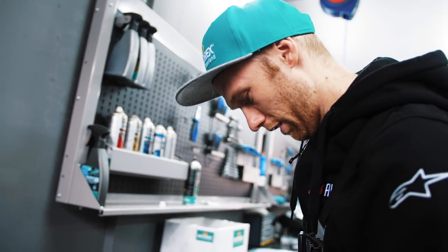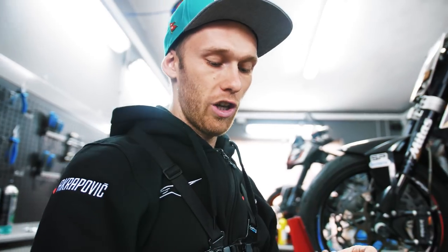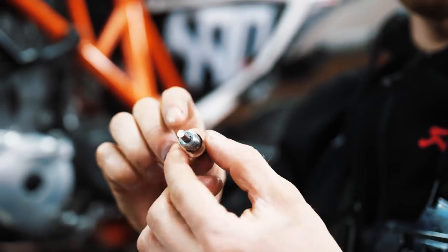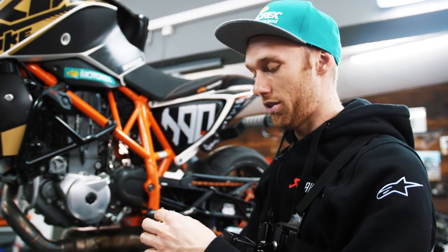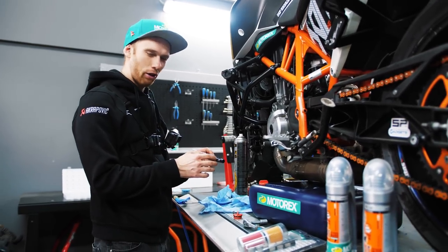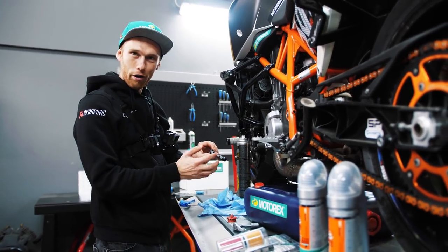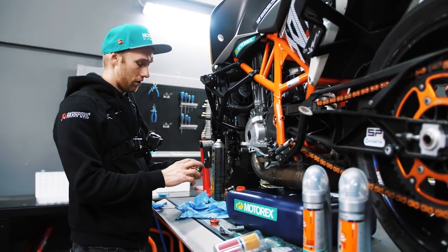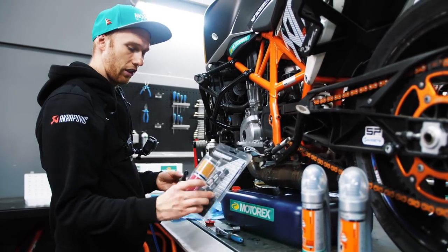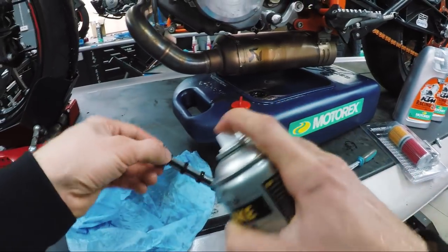Different bolts, different sizes. When you change something with a copper washer, you always need to throw away the old copper one and fit a brand new one — otherwise the oil is going to leak. Same with brake lines, same everywhere you have a copper washer. Also when you do a service, you have this wire mesh filter — a metal kind of filter. If it's dirty, bent, and already old, I prefer to change it. But this one was changed not too long ago, so even though the service kit includes a brand new one, I'm going to use the old one and just clean it with brake cleaner to remove all the debris.